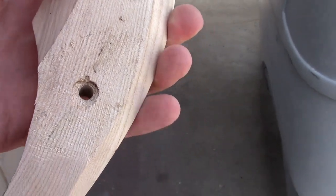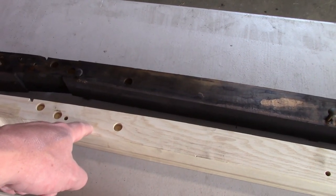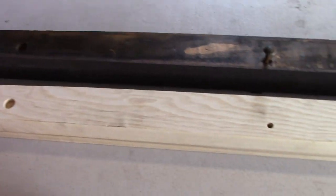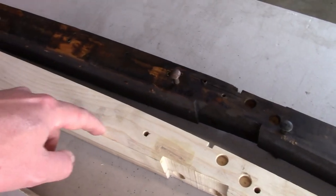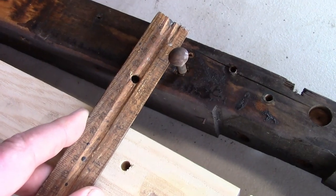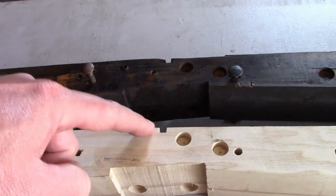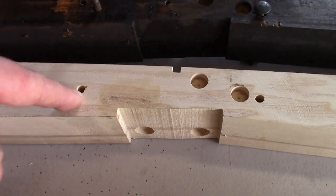The big piece that goes on the sides — I installed the right one and had a noticeable amount of difficulty. The mounting holes are more or less where they should be, but not quite. The problem is when you put all these bolts in, the inside sticks out about an eighth of an inch, whereas it should be flush with the steel like the original. After a little examining we figured out why: this part from about here forward is consistently about an eighth inch wider, and the mounting holes in relation to the groove are slightly further forward than they should be. So on the other side I had to fill in all these holes and redrill them.